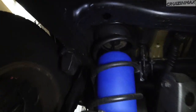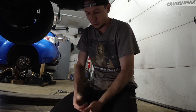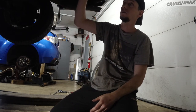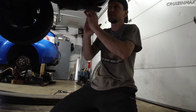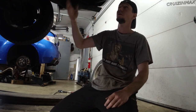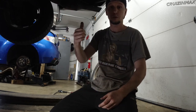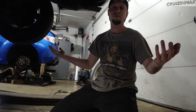How did I put the airbags in? Easy — I took the airbag, squashed it, held my thumb over the hole so it's kind of vacuumed, then after running the line through and cutting the bump stop, I shoved it in bottom-first, then squeezed in the top part. Then I pulled my thumb away and it just inflates on its own. No parts removed at all — easy.